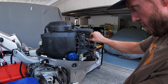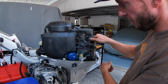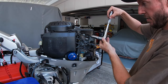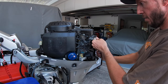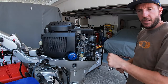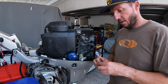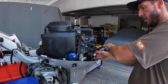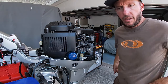Put her in. Now you just screw it down until you feel the washer seat, and then you take half a turn. So half a turn. Just like that. Done. Yeah, do that three times and the sparkies are done. That's the spark plugs done.